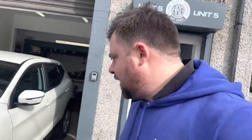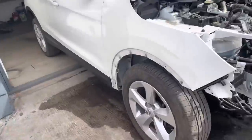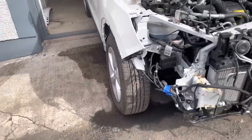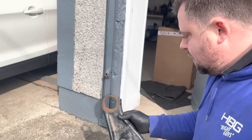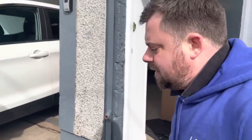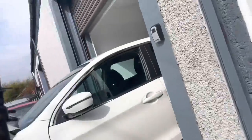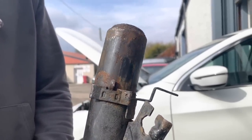It's the next day and we've got the Qashqai back on its wheels. As you've seen in the time lapse, we got the front strut off and the suspension arm done. The wheel's sitting a lot straighter now and I did manage to give it a run to the yard and back — it seems to be driving straight. The biggest problem was the suspension arm lost a bush in the accident and has a slight bend, but the biggest issue was the bent shock — you can just see the bend on it.